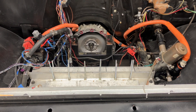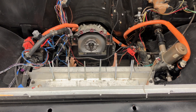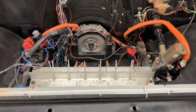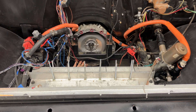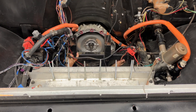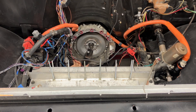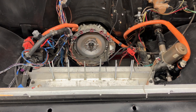The frame on these trucks is not perfectly parallel — it gets narrower in the front. I loaded this bracket from the rear of the truck, and now I need to take it out towards the front. Obviously the transmission is behind it, but I can't move it backwards. Let's see if we can get this brace out — this crossmember. If we can get it out, it'll make it so much easier to mount the new plate and lock out the input shaft. And she's out.